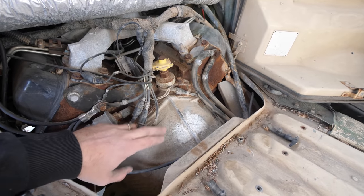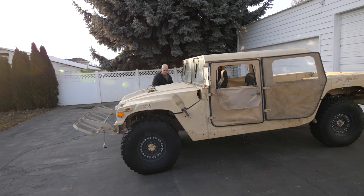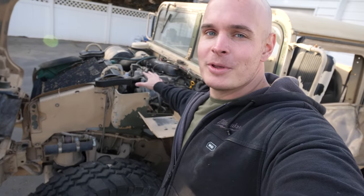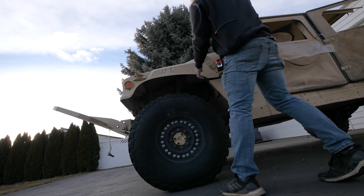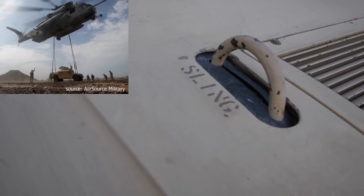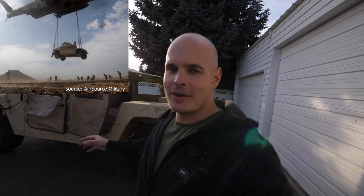Full access to the motor and the transmission is right here, and this is what we're going to be attaching our electric motor to. Underneath the hood, which opens up in a unique way, we have the motor which is coming out, as well as the alternator and the cooling system — all of this needs to come out to make space for the electric parts. On the front there's a bunch of hooks on the bumper as well as by the motor and on the back bumper. These are used to carry the Humvee via helicopter and throw it out of airplanes when they need to put a vehicle somewhere they can't drive it to. It's pretty impressive how much abuse these things can handle.